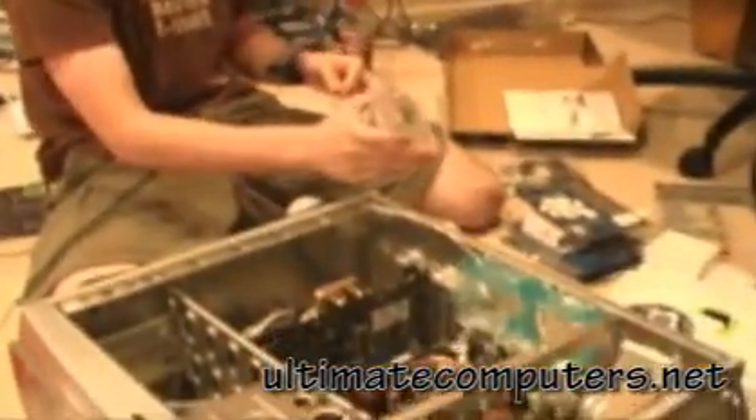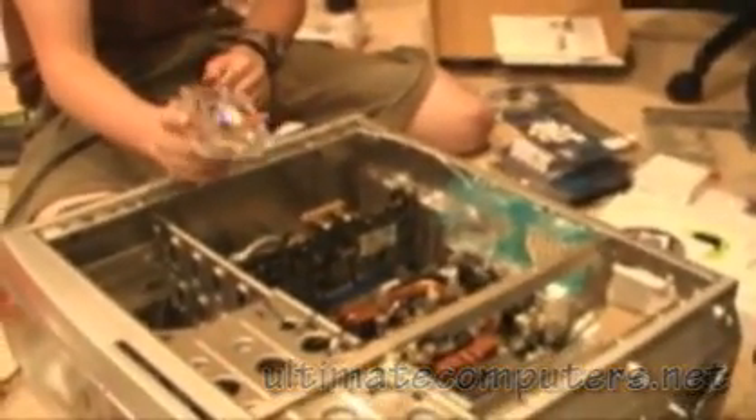It fit — look at that fit. That's close. Now we are mounting in the case fans, which are needed for ambient airflow within the case. It's important to make sure that you mount the fans in the right direction. The ones in the back should be blowing air out through the back, and the ones in the front should be pulling cold air in. In most cases, you want the label on the front of the fan facing in the direction the air flows.